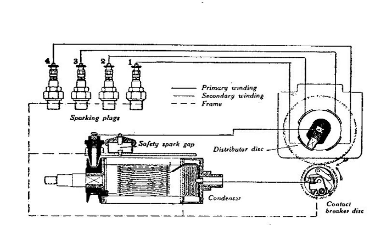The capacitor's function is similar to that of a snubber as found in a flyback converter. A second coil, with many more turns than the primary, is wound on the same iron core to form an electrical transformer. The ratio of turns in the secondary winding to the number of turns in the primary winding is called the turns ratio. Voltage across the primary coil results in a proportional voltage being induced across the secondary winding. The turns ratio is selected so that the voltage across the secondary reaches a very high value — enough to arc across the gap of the spark plug. As the voltage of the primary winding rises to several hundred volts, the voltage on the secondary winding rises to several tens of thousands of volts.